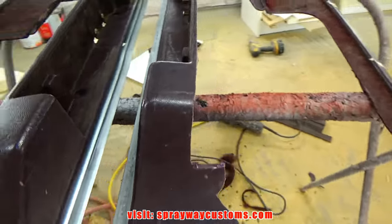Now it's time to put the fleece on. It's gonna start taking form now. I'm not gonna use no spray. I'm just gonna stretch it and put some staples in it. These are the staples I'll be using, quarter inch. Since it's not no big area, that's why I'm just gonna stretch it and staple it. I'm gonna staple it along there where I put that cove, also in that little crease there. And up here, I'm gonna staple in that crease. I'm not gonna worry about this part here. None of that.